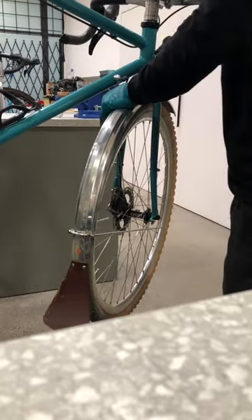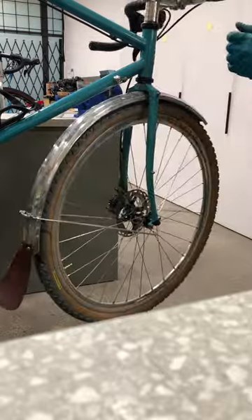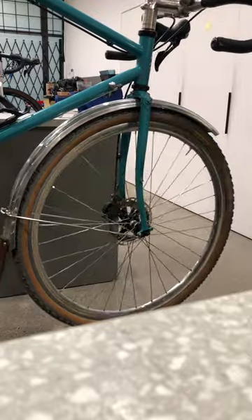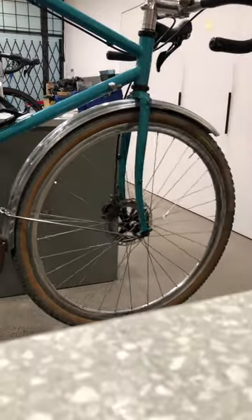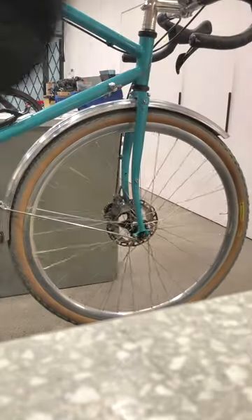With a bit of tweaking the front as well, and then reattaching the stays to make sure everything was running a little more true, things improved a whole lot. And you can see, here's the before and after — looks way better, and on the ride home, got no noise. Thanks for watching.